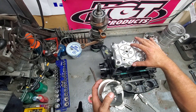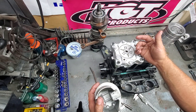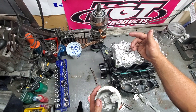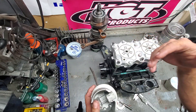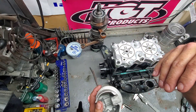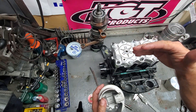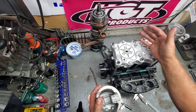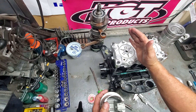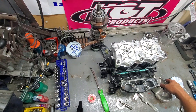Where you make power on any engine is timing and compression. The more compression you put in — same thing on a four-stroke with a supercharger or turbocharger — that's all compression. You're adding compression to the engine, putting more pressure in that cylinder, making it work harder with a denser charge to explode. The more advanced you can go with timing, the hotter it's going to go. You want to be right on the edge of detonation without detonating — go a little too far and you're doing a complete rebuild.